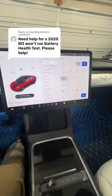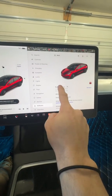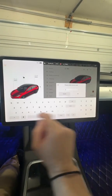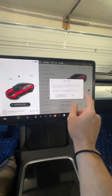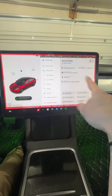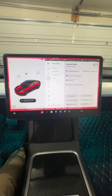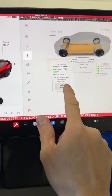Are you wondering how much your Tesla battery is degrading? Let me show you how to check that. First, tap on Software, then press and hold 'Model 3' or 'Model Y' — whatever yours happens to be — for about five seconds, then let go. You want to type in 'service,' which will bring you into the service menu. Type OK, and once you do that you'll be in service mode. Go to High Voltage, tap on HV System, and that's what you're looking for — the health test.